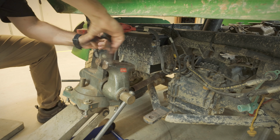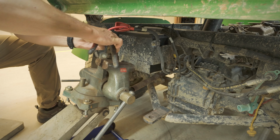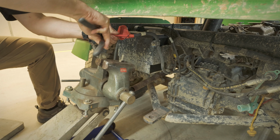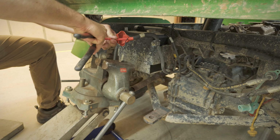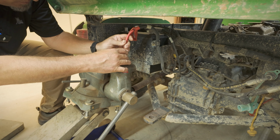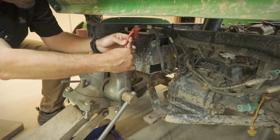You got to strip a little bit more wire. And yeah, it takes a little bit longer to do it, but easier to do it right now than have to keep fixing it over and over again, because those other ones don't last too long. All right. Make sure it fits. This is a 4-gauge wire, and this is a 4-gauge terminal.